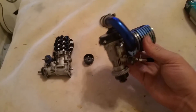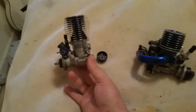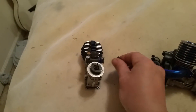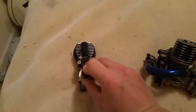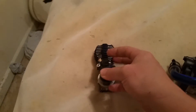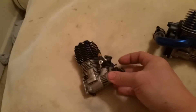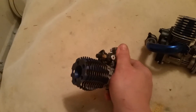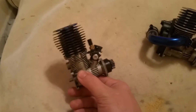This is a 2.5, but it is not an R. The 2.5R looks like the 3.3R, just smaller. Those are the parts of a nitro engine. They work very similar to a two-stroke engine, except they use compression instead of a spark plug for ignition. That's why compression is such a big deal with these — you have to have good combustion, just like with a diesel engine. These are essentially a two-stroke diesel engine.